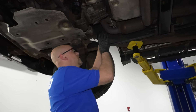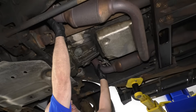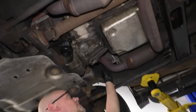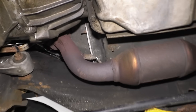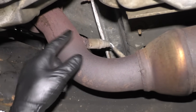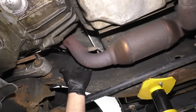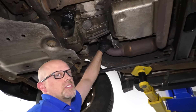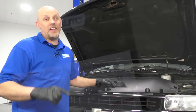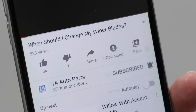Or the oxygen sensors. There are four oxygen sensors on this vehicle — two in the front and two further down the exhaust. The ones in the front are the ones we're concerned with; those monitor the engine's fuel-air ratio. Any unburned fuel or air that gets into the exhaust is monitored by the O2 sensor, which sends a signal to the computer to make adjustments. If the O2 sensor isn't sending the correct signal to the computer, that's going to cause an issue. I hope this video helps you out — if you enjoyed it, please subscribe to our channel, make sure you ring the bell, and turn on all notifications so you don't miss any of our videos.